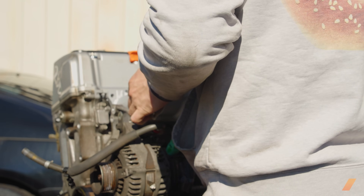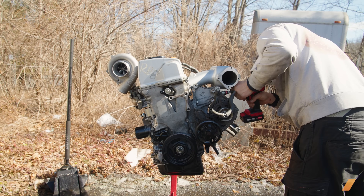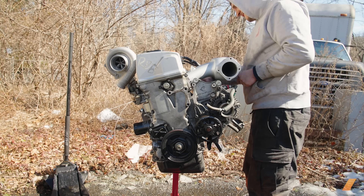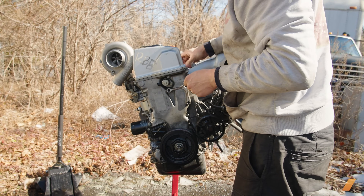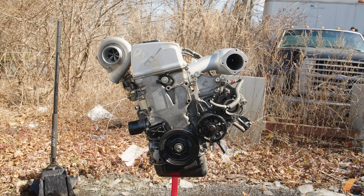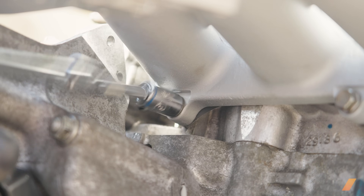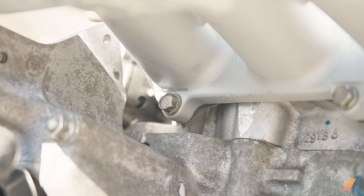It's fitting now! That looks pretty good, that's what I'm talking about. Now if you're confused, let me bring you up to speed. There's a JDM K24 and a USDM K24A2 — pretty much identical motors, however the USDM one uses USDM components. Normally what people do is source a USDM water pump housing and bolt on the accessories. At this point of the swap I didn't have that yet, so I'm foolishly using the JDM bracket, which was in the way of reaching some of the intake manifold bolts.